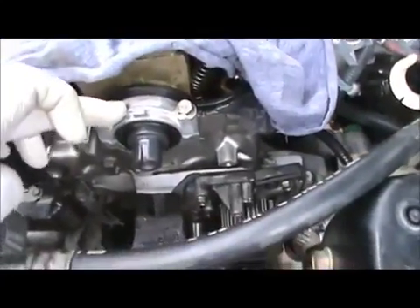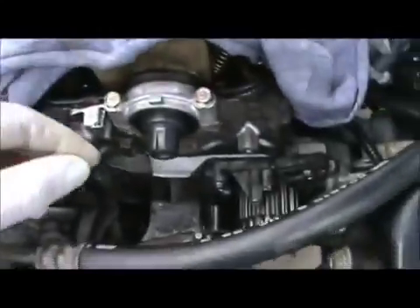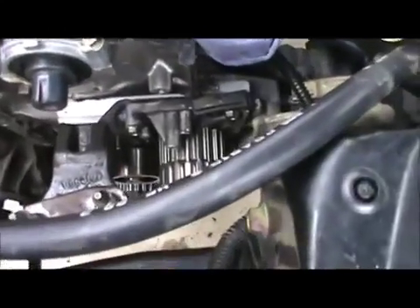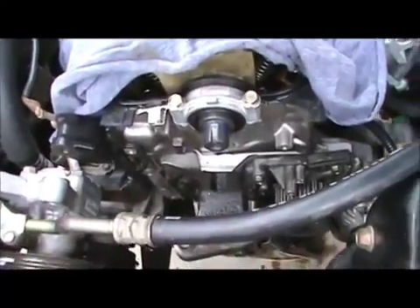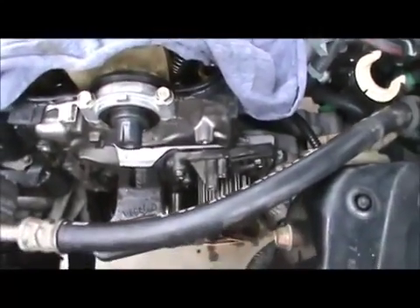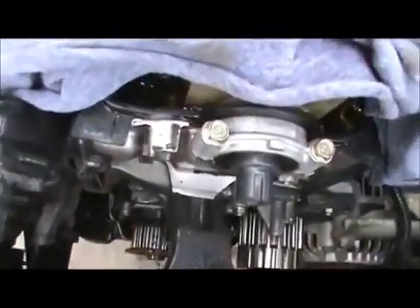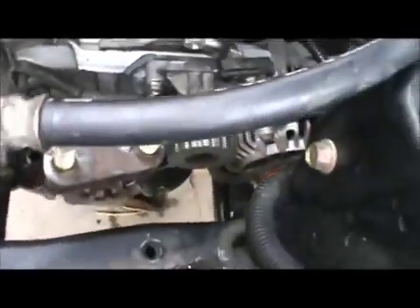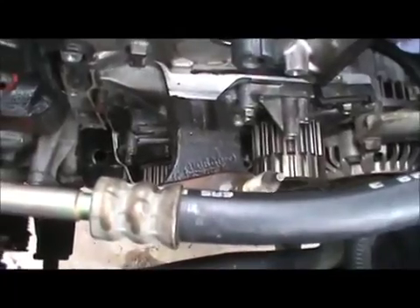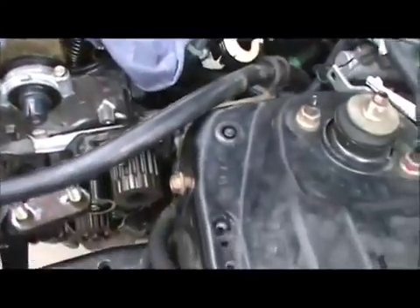To install the seal, there are special installer tools. I went to the store and got a bunch of larger impact sockets — I'm just going to use that to install the seal. I'll pull this out with the shaft-type oil seal puller, put the new seal started, put a large socket that fits right around it, and tap it in. By the way, you want to put a little bit of clean engine oil or grease on both ends of the seal to help it slide in. Also in the kit he got there's a tensioner — we're going to take off the pulley tensioner and the spring and change those two things as well. It's just one bolt holding it on, then we come in with pliers and pull the spring off, put the new spring, put the new pulley.